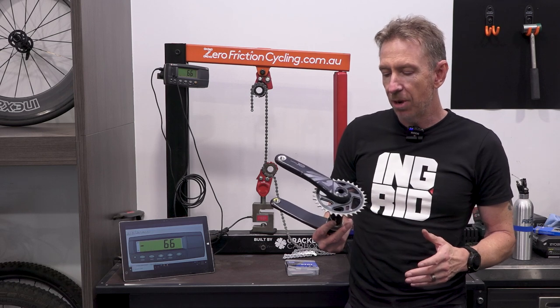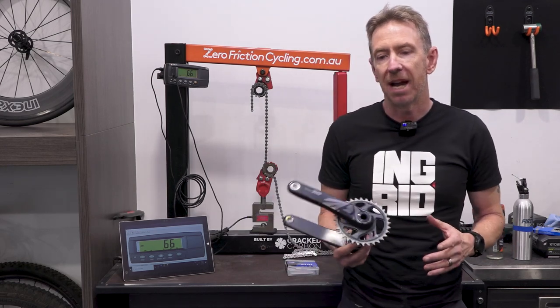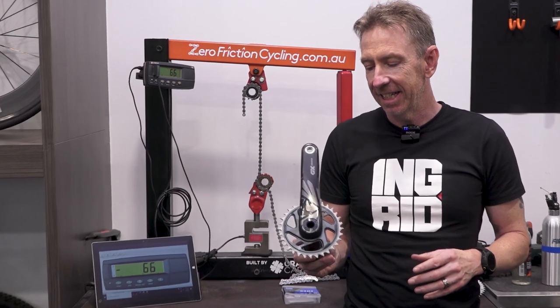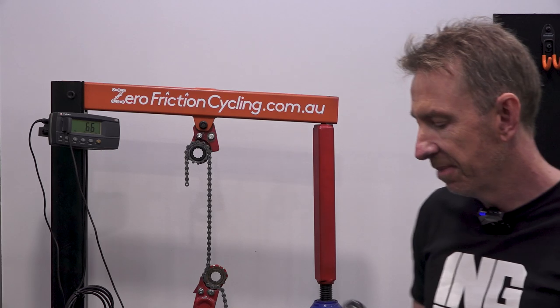So most bicycle chains will be at least strong enough that we could do around 6,000 watts of power, which obviously I don't know of anyone that does. I think the strongest track sprinters might sometimes peak at powers a bit over 2,500 watts. So in theory there's a really big safety buffer on the tensile strength of our chains versus what we can possibly produce. In most normal circumstances, what mortals are doing on, say, a road bike, the newtons of force through the chain will generally be in the hundreds, and we have, in theory, a chain that is at least 8,000 newtons strong. So a pretty big buffer there.